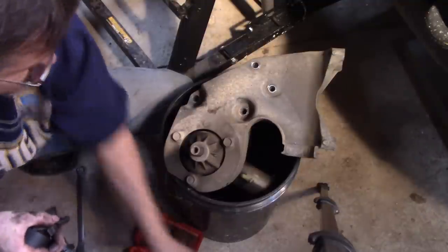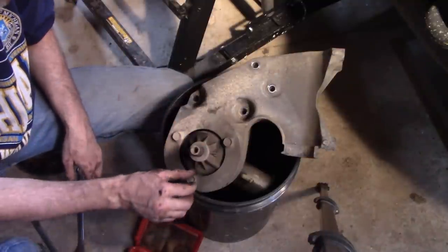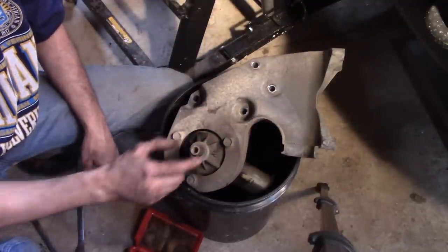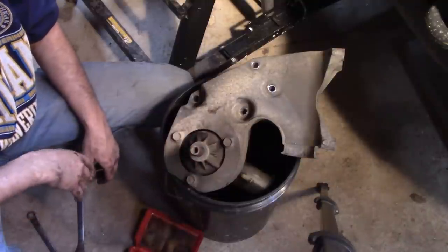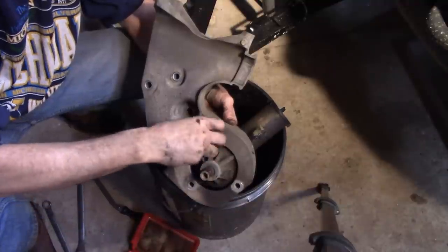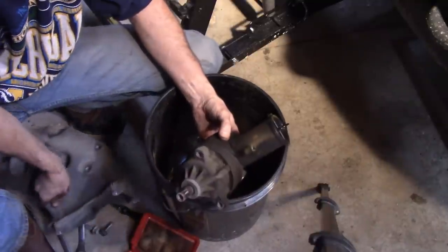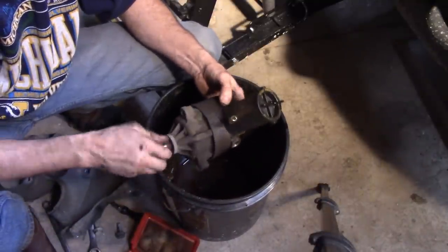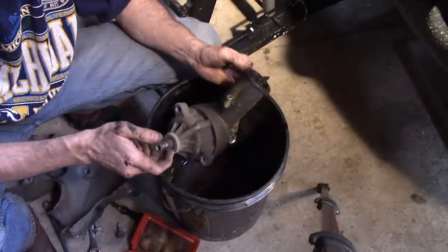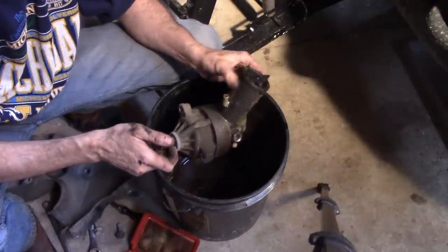Removing the pulley gives you access to three bolts — they look to be about 18mm. Actually the heads on these bolts were 17mm, not 18mm. Take those bolts off and the pump drops off the back of the bracket. There is our old pump. Most remanufactured pumps require a core, so make sure this is in good shape to put back in the box. Let's get our new one out and start putting it back in.